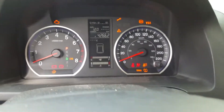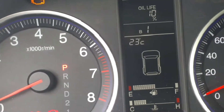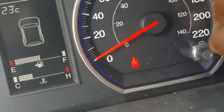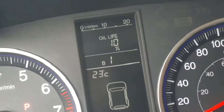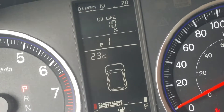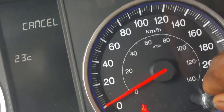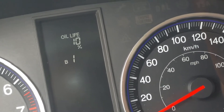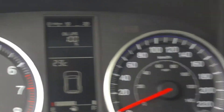Now I'm gonna show you how to reset your oil life light. Put the key to the on position — don't start the car. If it's not on the oil life screen, you're gonna cycle through by pushing this knob right here until you get to where it says oil life. Push the knob down and hold it until it starts flashing. Then twist the knob to select, and once oil life is flashing, press the knob one more time. Then hold the knob down to reset it until it's at a hundred percent. That maintenance light should disappear now.